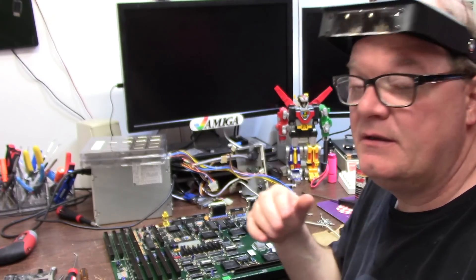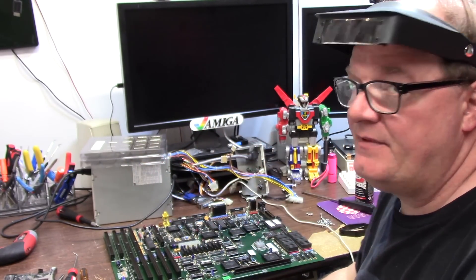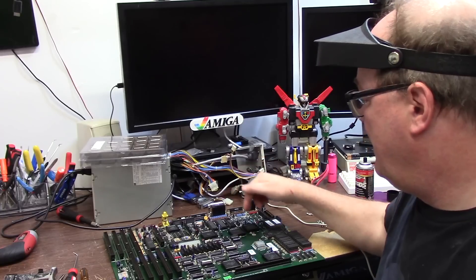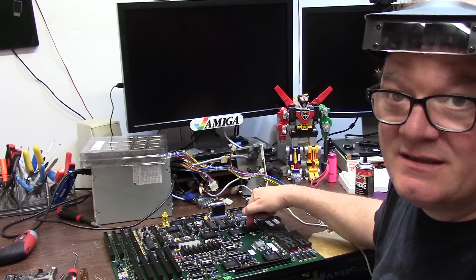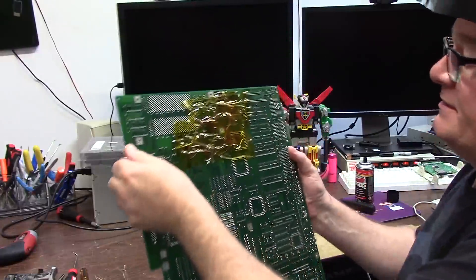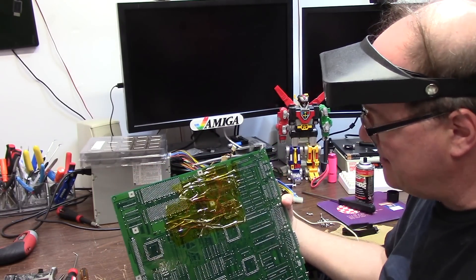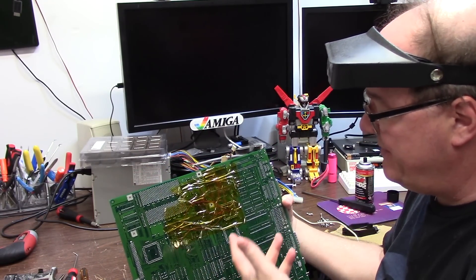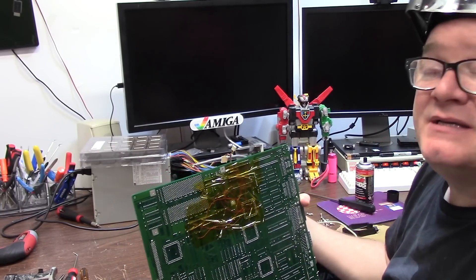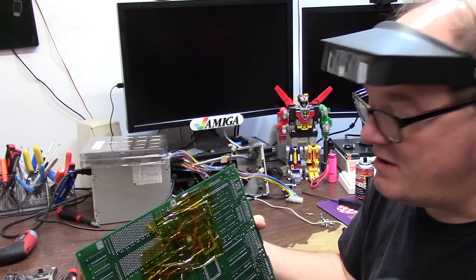I removed the DMAC, put DiagROM in, put the DMAC back in. I took the DMAC out, put it back in, DeoxIT'd it. But I think this socket is on its last legs — this socket has seen more abuse than Jesus making bread, because that's the prime candidate for the spaghetti noodle here on this board. And what sucks is everything's still there tight, wire side. The problem is I have to replace a socket, which means I have to remove all these wires.